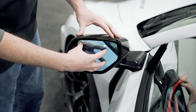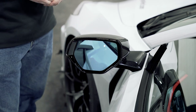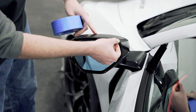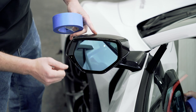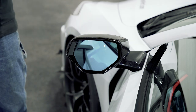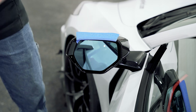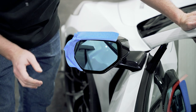We start by removing the mirror glass. This one is different from the OEM — it has our Paragon wide angle mirrors on it, so check those out as now would be a good time to install those as well. We need to align the outside edge with some tape, as we have to stick a screwdriver down behind the mirror glass to release some clips. We'll get the tape put on and roll it up and over, just try not to stick it to the actual mirror cap because we do need to remove that.